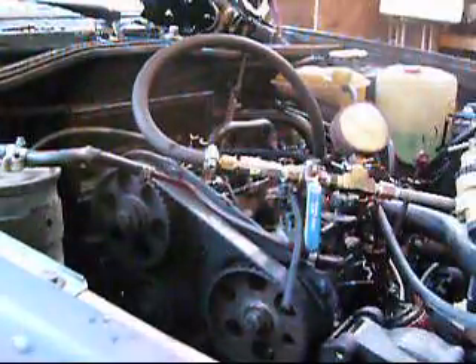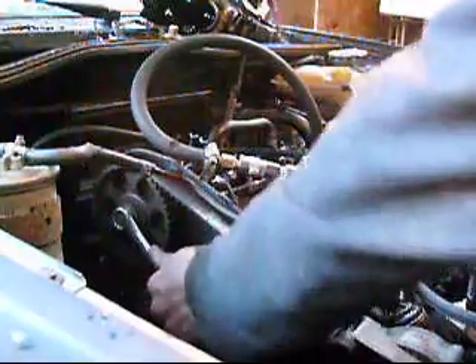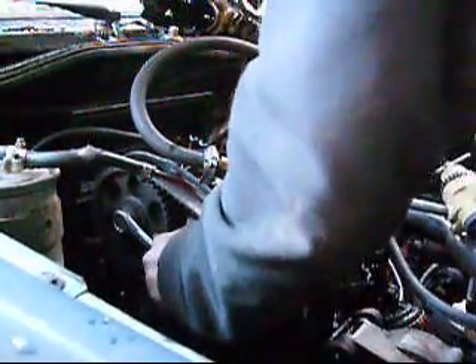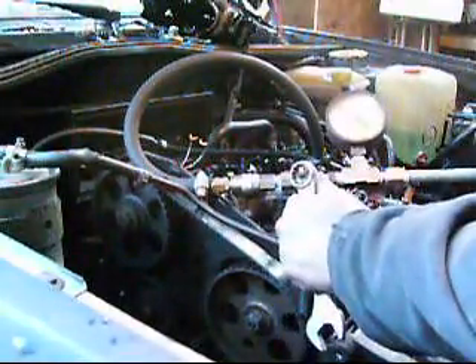You heard it rotate there — an exhaust valve opened up and all the air pressure was lost out of that cylinder. So we're just going to rotate that back again. It's a little tedious sometimes; you've got to do it a couple of times. Even with 100 psi in there, you can see that's quite a bit of compression to crank against. That looks to me about top dead center there, so let's try that again. Let's get this calibrated — notice how that dropped down; it's the finicky part of it. You want to set that to 100, kind of balance it out, and then we'll pressurize this.